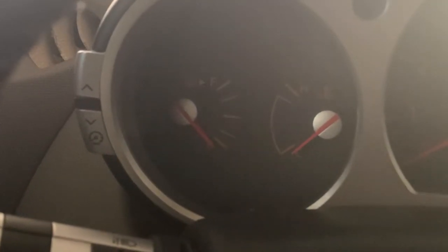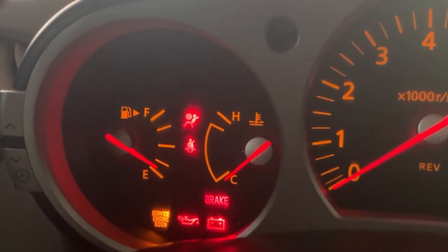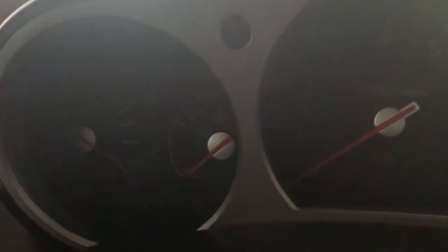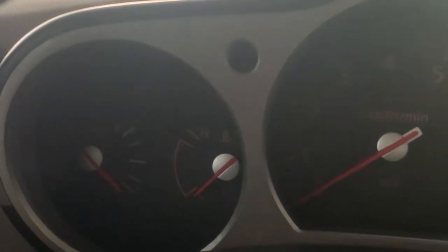The car's off. You're gonna turn the key and the light's gonna be on, and as soon as you see it start to blink, you turn it off. You do that four times — on, start to blink, turn it off. This is the first one, see it's on. Soon as it blinks off, you turn the key off. Then you do it one more time, and then off, and then another time, and then off. This is the last time.